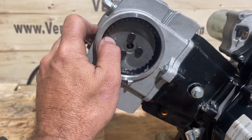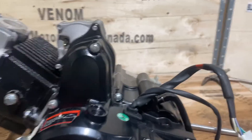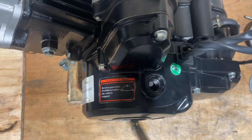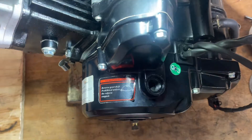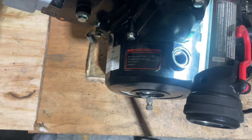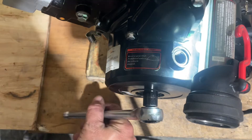The timing mark lines up with this little round circle here. Looking down inside at the top, we're going to look for our timing mark. We're off it a tiny bit - it probably just kicked forward a little. To rotate it to get to the timing marks, never rotate backwards. This engine runs counter-clockwise, so you rotate it in that direction.